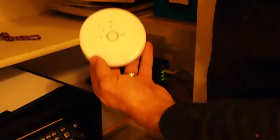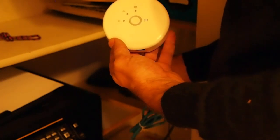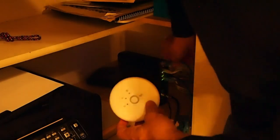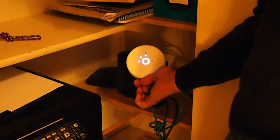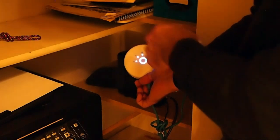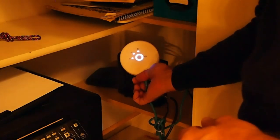First off, to get this up and running, you're going to have to plug the base station into your home network. You need a Wi-Fi base station with wired Ethernet ports available to get this up and running — I did try this product without the hard-wired LAN port and it does not work. Plug the device in, power it on, and it will connect to your home network and then try to connect to the Hue website. It's important that it's plugged directly into the router — I tried plugging it into an extra port on the back of my VoIP modem and it did not work.